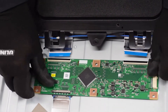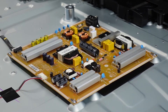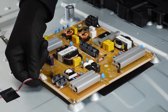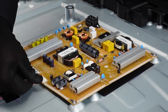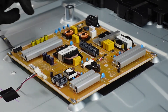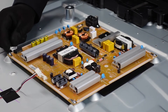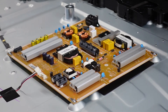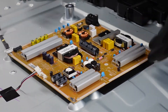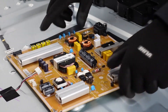There was that piece of adhesive — and that's going to be your T-con board. The power supply is the last one. This connector goes back to your backlights and is very fragile, so be careful. Pinch down at the top to release the lever and pull it directly out. The corner connector: squeeze it on the sides and pull it out. Then just some screws — be gentle lifting up. There is no adhesive thankfully, and that right there is your power supply.